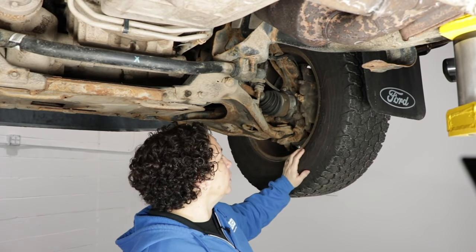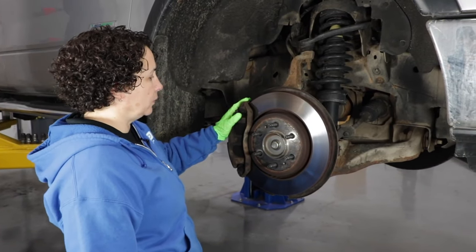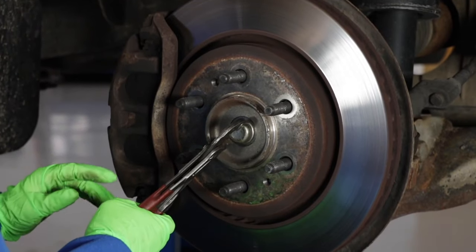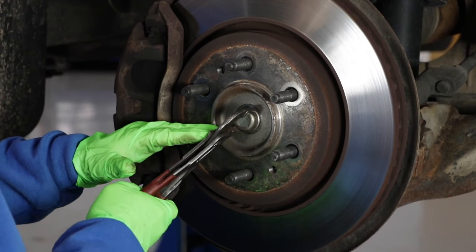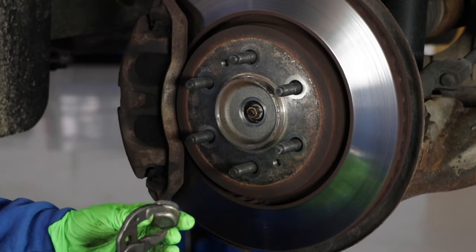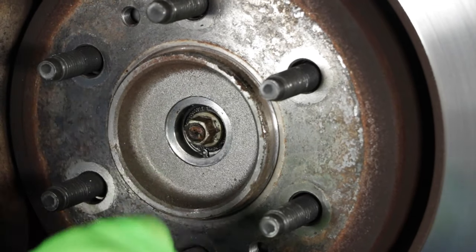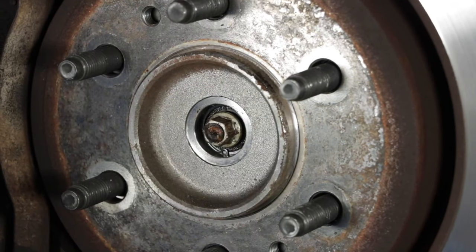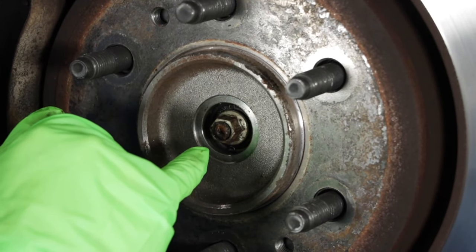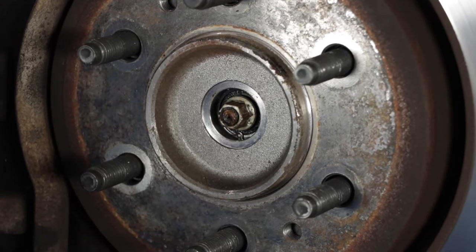So we're going to lower it, take this wheel off, and check for that nut loosening. Once you take your wheel off — you've got this little cap. I just take a pair of open pliers, wobble it back and forth, and pop that cover off. You don't ever want to put holes in there because you don't want water and grease getting in there. That should not do that. So now we're going to look up the torque spec. I'm going to take this off, make sure there's no damage to the threads — and there's no damage. I'm going to re-torque it and see if it holds.